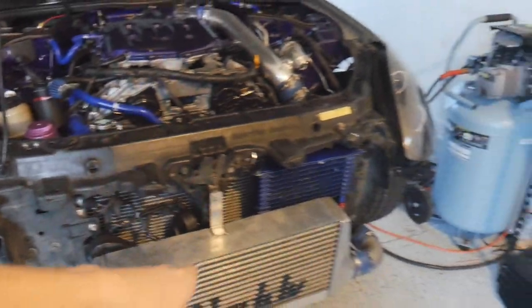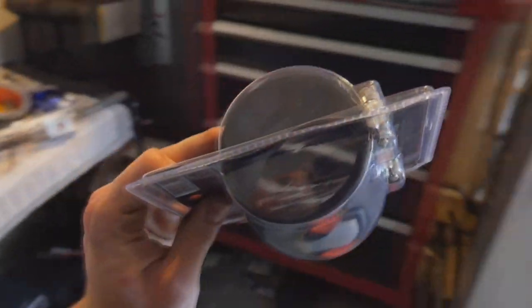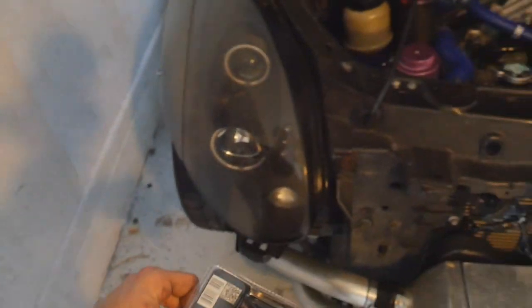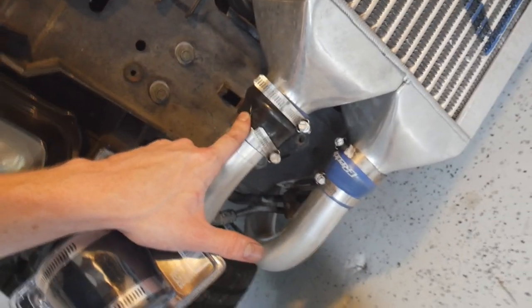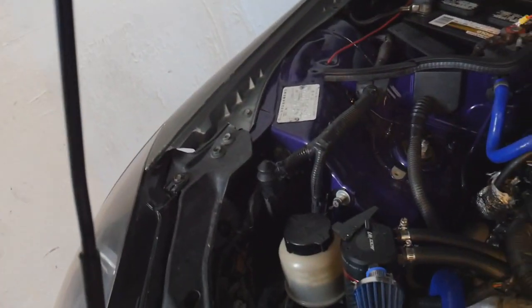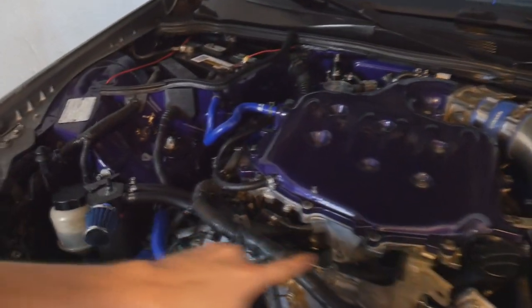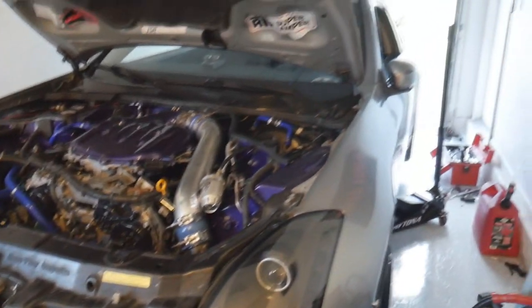Say hello to my little friend. Alrighty guys, so we got everything back together on the G35. You can see we got our intercooler back up. We fixed all of our couplers, all except for two couplers - unfortunately I got the wrong size couplers for these right here. I guess I went from a two and a half inch to a three inch because it's just way too wide, these aren't going to work. I just went ahead and put some duct tape - hopefully it'll stop the leak a little bit more than before, but I'm not going to be running with this long term. I just wanted to do this to see if we fixed our smoking issue, which would have to do with our catch can setup. Got our vented catch can, our new PCV system is good, tops of the valve cover ports to the catch can, venting out at this filter, rear valve cover coming up to the intake, and our PCV is blocked off. Hopefully the turbos are not blown and hopefully it doesn't smoke again.